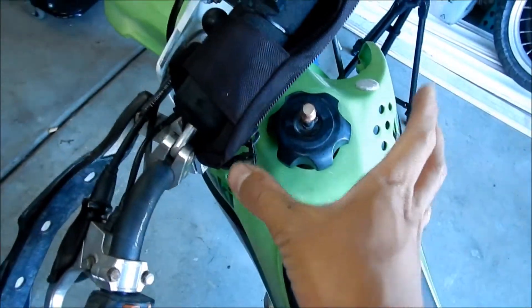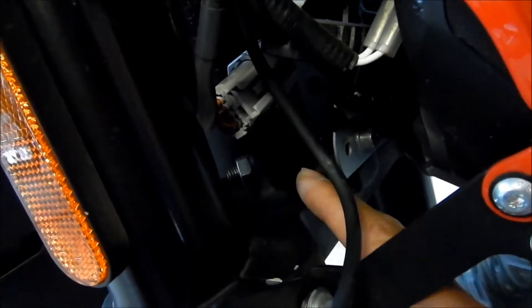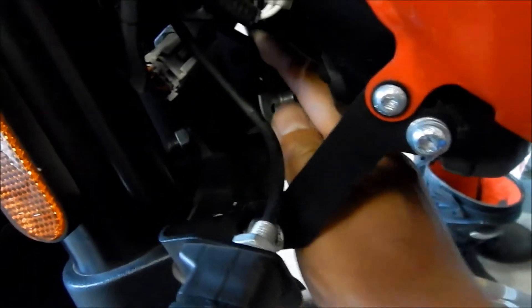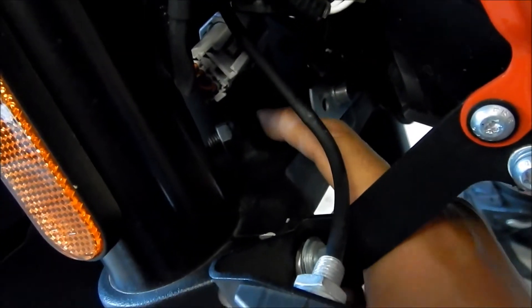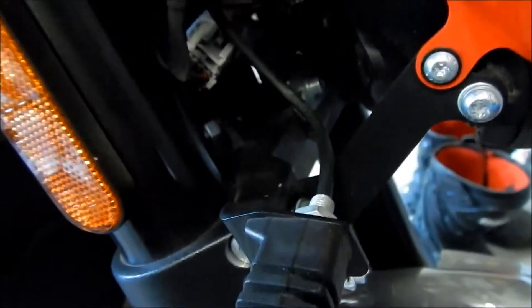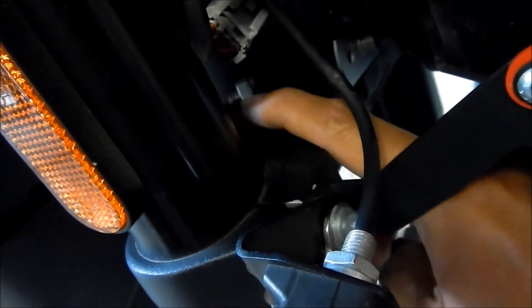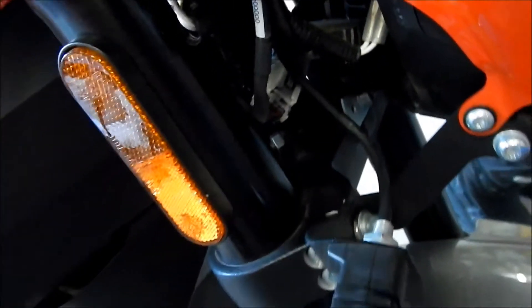So basically we're using the gas tank as a stop. I believe this other bike has something like that. If you look in here very carefully, there's the stop — it stops here on this little tab thing in the center. That's where it stops. It's just metal to metal — it's going to wear out after a while. But here, this is the stop right here and they've installed kind of a screw with a stop nut, so you can adjust how much you want the handlebar to travel.